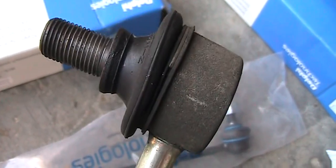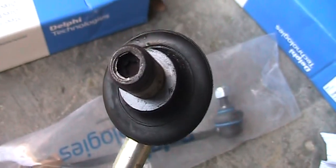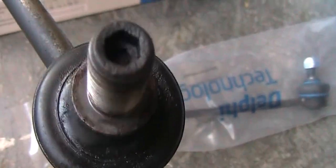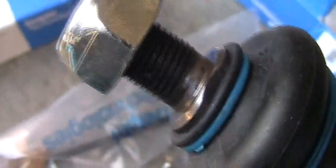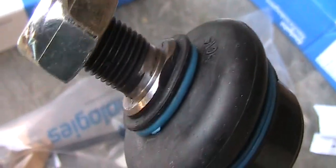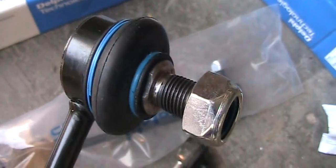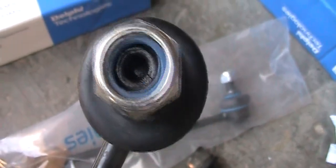And on the old design, the back is all round, which is not that good because they base it on this Allen nut to hold it so you can turn it. This is the bottom. And a lot of the time this one strips out or rusts out. On the new one it is better because they have a flat area where you can put maybe a 40mm wrench or something to hold it back so you can turn the screw.